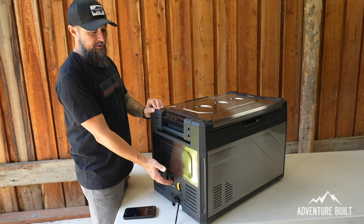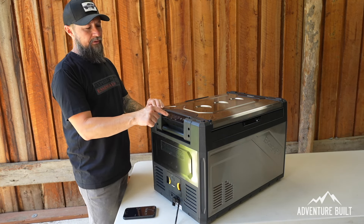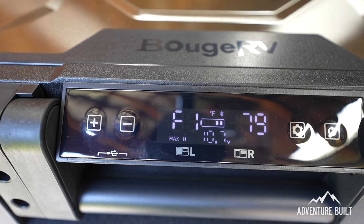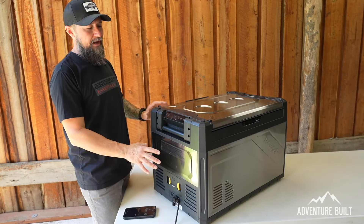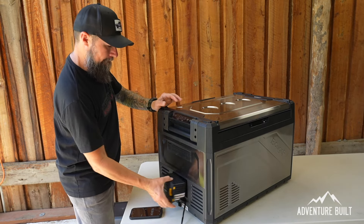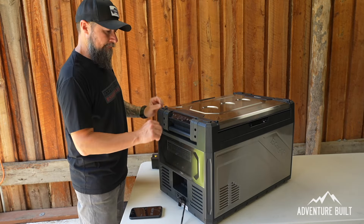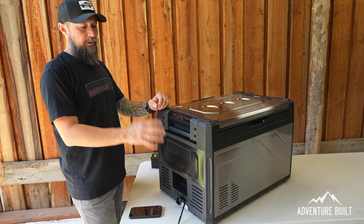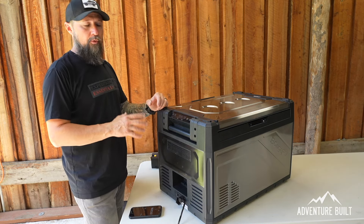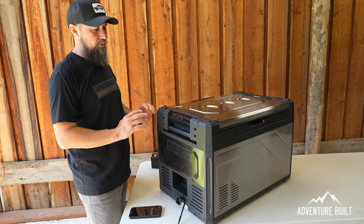This happened twice now — with the integrated battery charging, the compressor turned itself off and it's giving me an F1 error code. I'm going to pull the battery to ease the load so the fridge isn't having to do a major cool down and charge the battery at the same time. Pulling the battery and unplugging then re-plugging seems to have restarted the compressor.